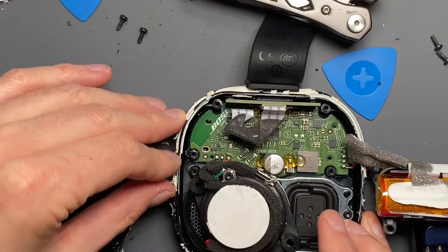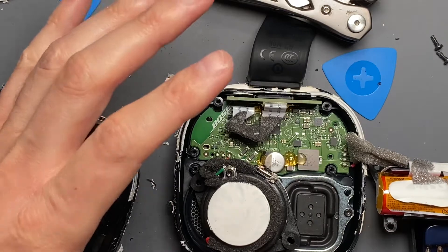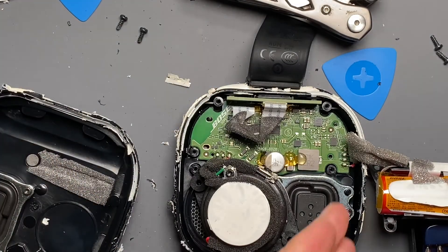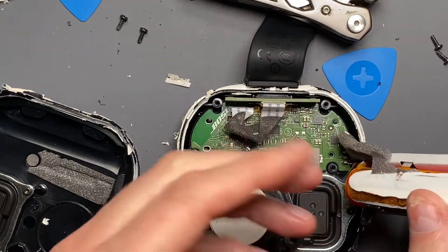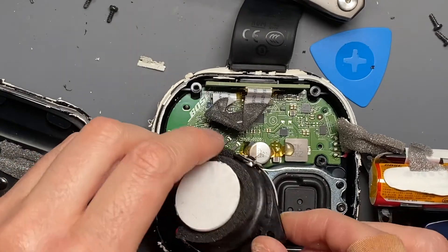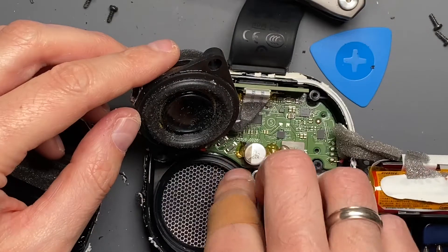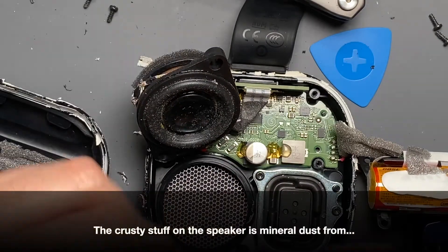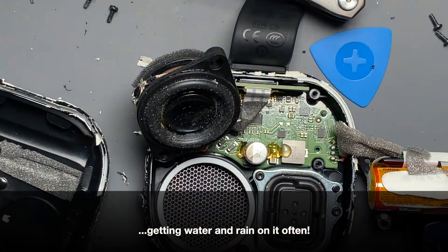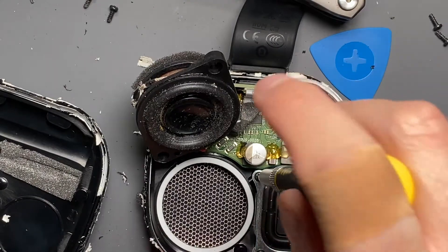There's not really anything left mechanically, so it's going to be held together basically by the silicone adhesive. When I do replace the battery — not yet, I wanted to see how it would be done — it's nice to know I can just pop this open. The speaker comes off nicely and has a little gasket, so you don't have to worry about actually resealing the speaker, which makes sense in assembly because if you had to put a sealant down there, you might get it on the speaker cone and that could affect performance.